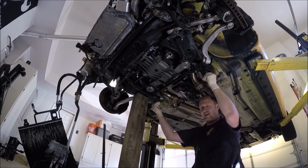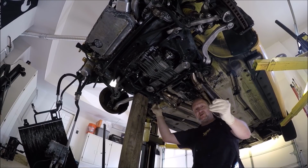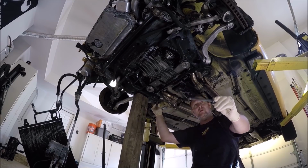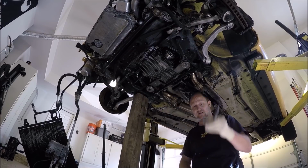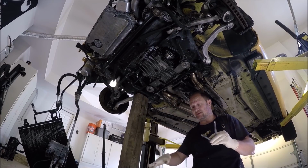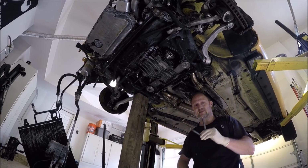And go ahead and take these 18mm bolts off. Again, as I stated in the beginning of the video, technically you're supposed to replace all 4 of these as they're stretch bolts. I'll give you all the torque numbers as we go along. I'm going to put the DTS bar on, and then I will go over the torque numbers and we'll torque some of this stuff down.